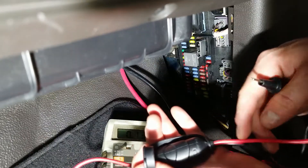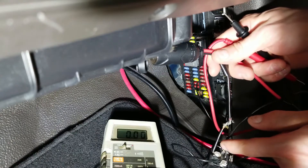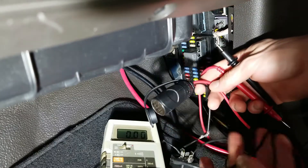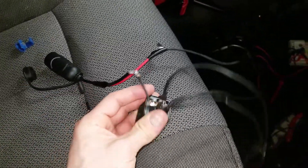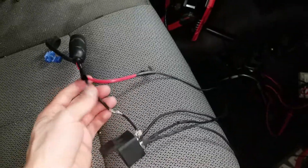The wire I just connected I'm going to connect to the positive end of the socket — that's the red wire; the black is the other one, so make sure you connect to the correct one. The other end of the socket connects to the relay. So I have positive 12 volts going into one side of the socket, the other side going to the relay — either pin 30 or 87, it doesn't matter which since all it does is close the circuit — and then the opposite side of the relay spans across to ground. I already have a wire connected directly to the battery ground, so I'm splicing in there. That completes the powered part of the circuit.